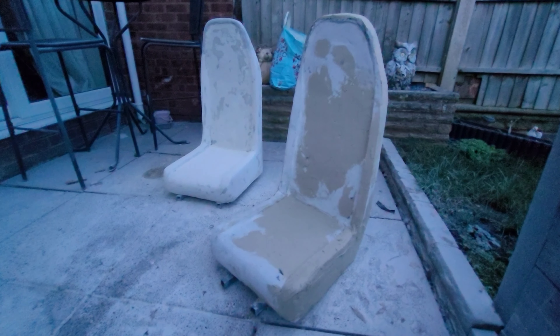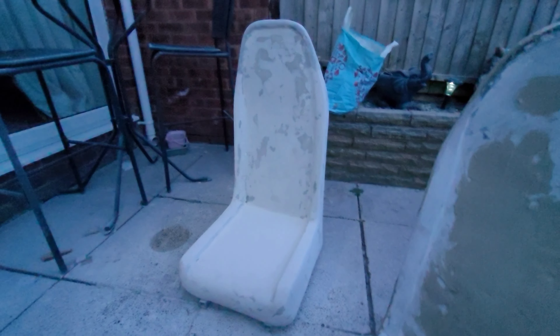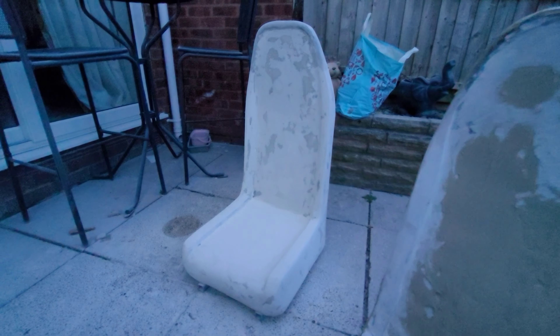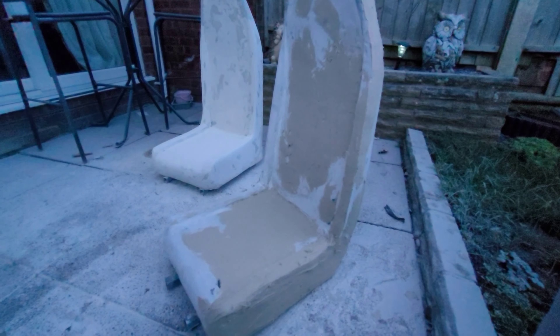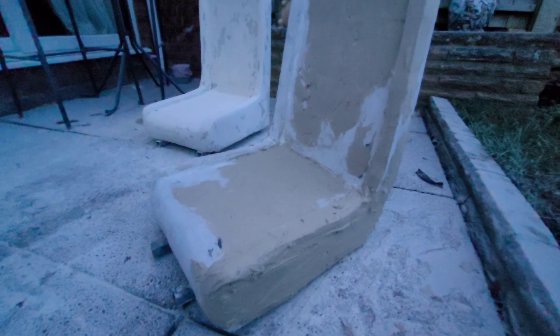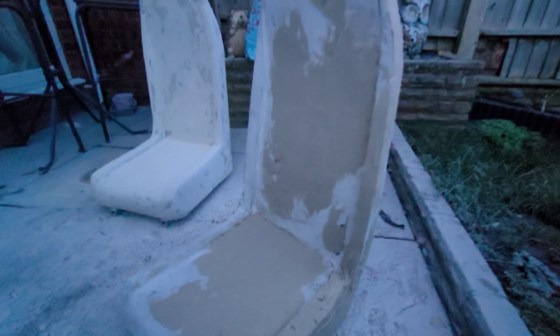Part two - doing some work on the seats. I've put a picture up of what it looked like at the start. This second seat has come on quite a lot. The other one - the first one over there - was kind of already there anyway, but it's had some work done and some flatting back since. It's also due a top coat once the shape is right, which is not quite there yet but not far off - just needs some work underneath and right on the edges. This one's going to be the same. There is enough room in the car for both seats - a lot of people asked about that. It's now on its third layer of fiberglass and its second layer of filler - this is just rough as it goes on.